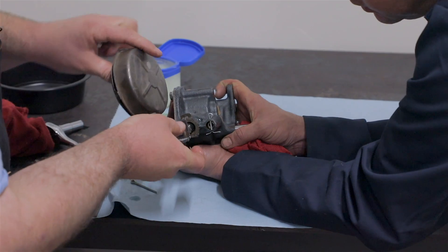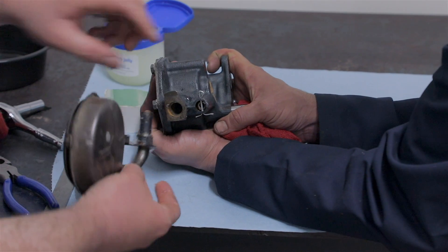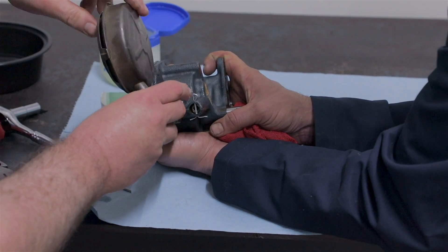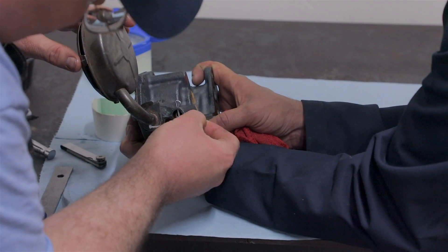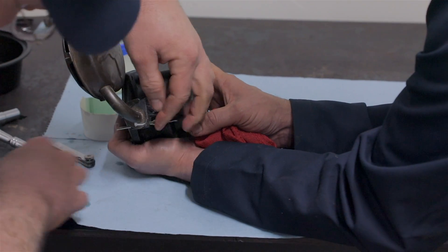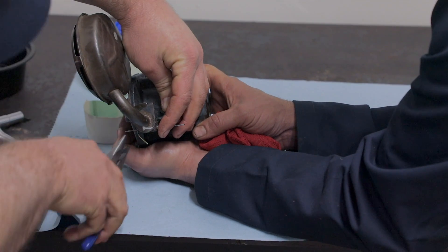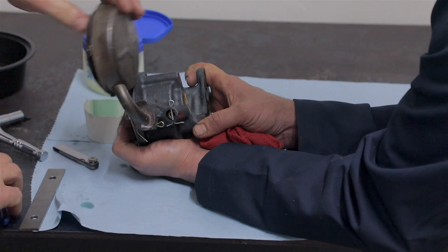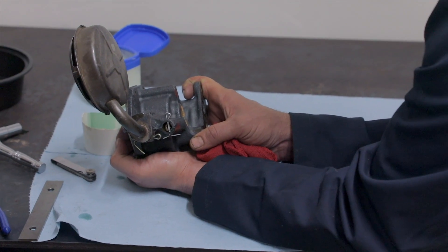This will be submerged, and the ears go around the little casting right there. See, it just has limited motion like that. Then we go and insert our cotter key and bend that over. And there we go — we have ourselves a rebuilt oil pump. Beautiful.